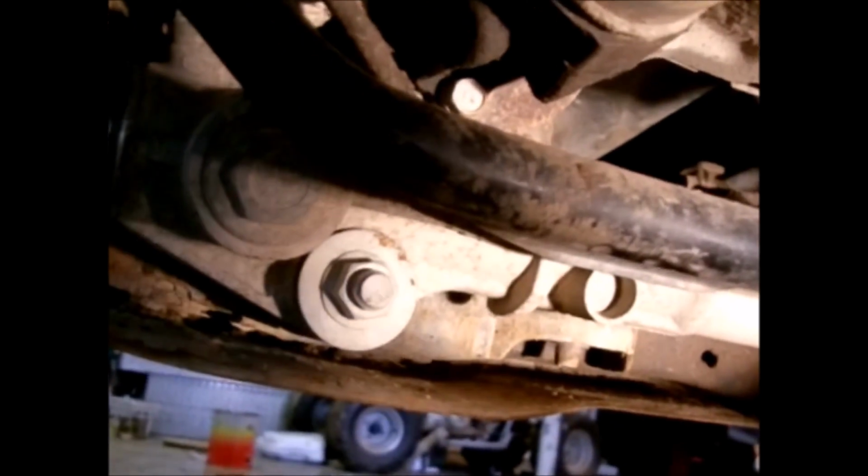And of course the steering shaft. I have to clock the steering wheel to keep up with it. Then take this pinch bolt out of here, spread this, and then knock this off of the steering shaft. And then of course there's a pressure and return line back there. So it's a pretty lengthy little job, but not too awful bad on this particular setup. Some of them are a lot worse. So we'll start taking things apart and show you where we go from here.